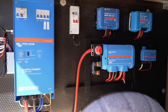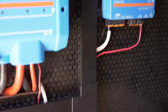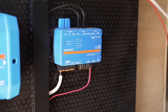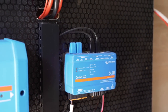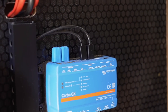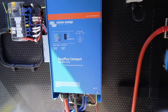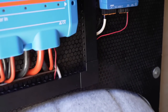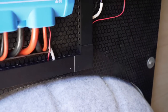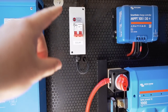I'm really impressed with how neat it all looks. I've also added some black trunking that runs around, mainly for the data cables that feed the Cerbo GX - little VE.Direct cables, basically like USB-style connectors that feed data from the different devices. I'm waiting for a cable that will join the Cerbo GX to the big inverter, which will route around in the trunking. The trunking came from Amazon - you get a big pack with corner pieces for around 20 pounds, and you get tons of the stuff.